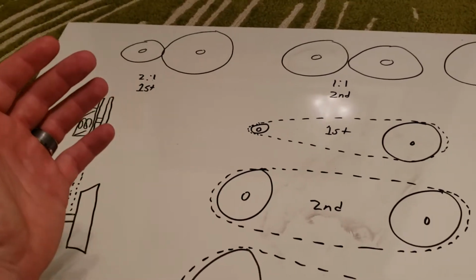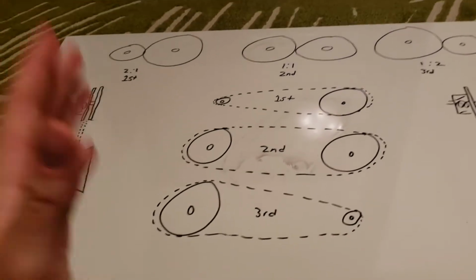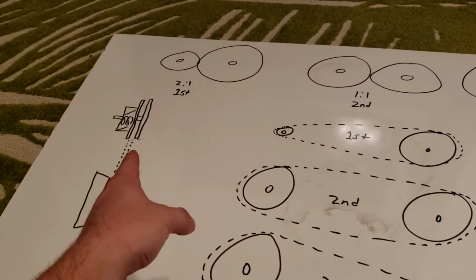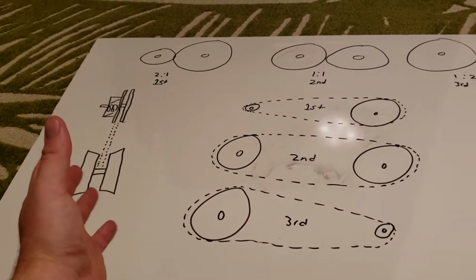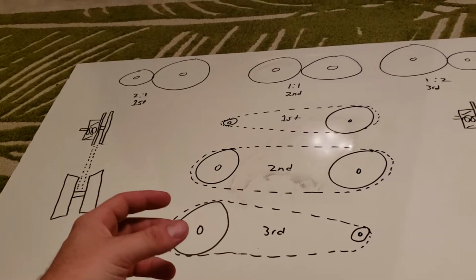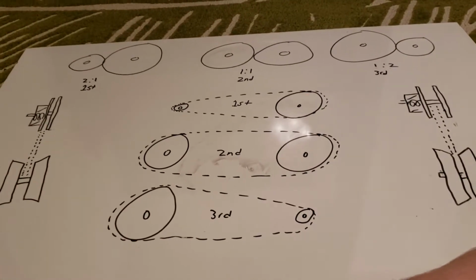Now, with a golf cart that just has two people, unmodified with the factory tires, they've calculated that spring weight is able to manage the engine RPM balance with the load so that you're not overexerting the engine. It's not going to hurt itself, and it's also going to have good acceleration.